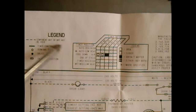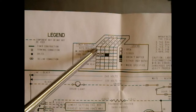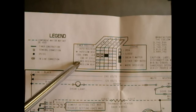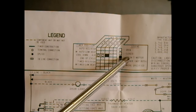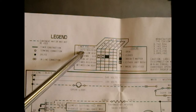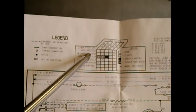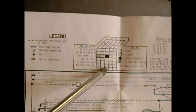Testing between the TM and WB terminals on the back of the timer: with the heat set to auto regular or high heat, you should find an open circuit between those two wires — the open box on the schematic means open circuit. But set it to timed regular or high heat and the connection between those wires should now be closed — the continuity alarm should beep. Similarly, between the BK and R terminals set to auto high heat or regular heat, the continuity alarm should sound.